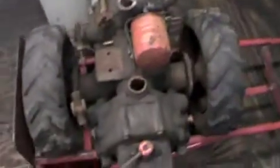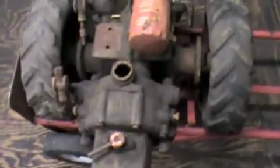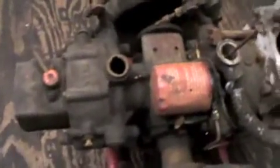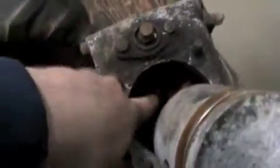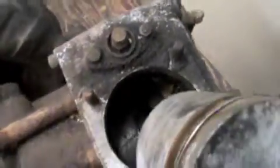I also got a transmission for an L8 or an LI, something like that. He really wasn't too sure. Been sitting outside without the filler cap or anything. The engine is full of water, right about up to, well, you can probably see it, but it's all frozen. Connecting rod unfortunately is broken. It's cracked down the bottom. I don't know if the piston is really salvageable.